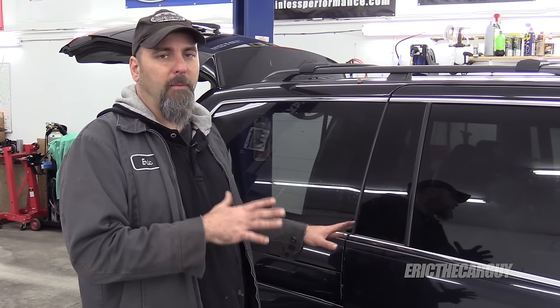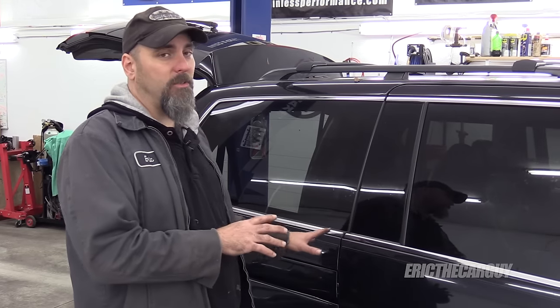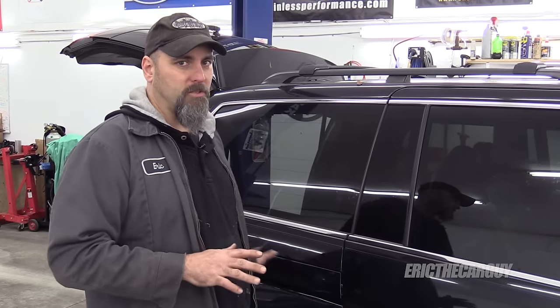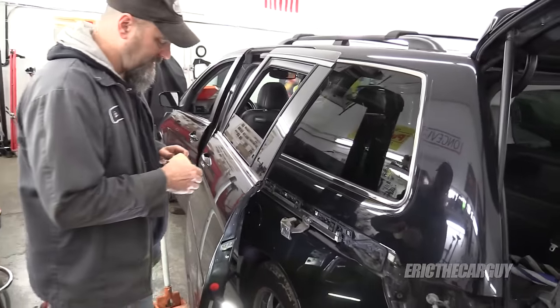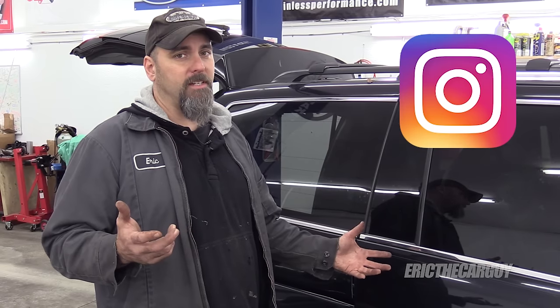The proper way to do it is to take apart the interior. I'll put a link in the description to a previous video I did on a 2001 that shows that procedure in a little more detail. If you've got one side that's bad, the likelihood that the other side is also bad or going bad is pretty high, so you might consider doing both sides. You can do that same test to find out if you have bad rollers on the opposite side. I'll put a link in the description to additional information, tools, parts, and related videos. If you have automotive questions not covered in this video, head over to ericthecarguy.com. Be safe, have fun, stay dirty. Thanks for watching. I'll see you next time.